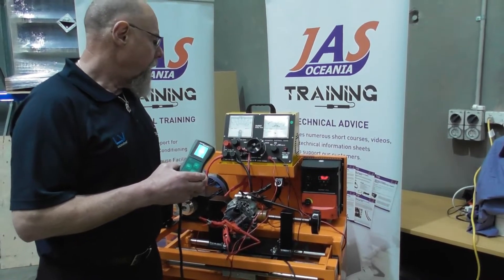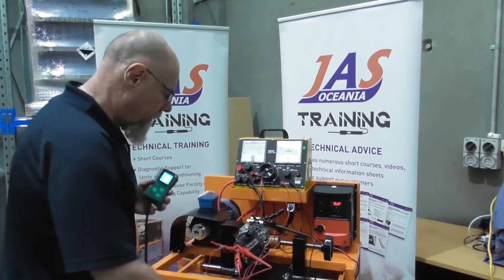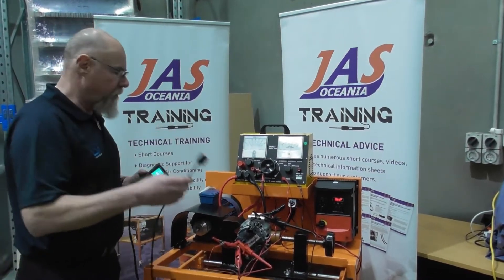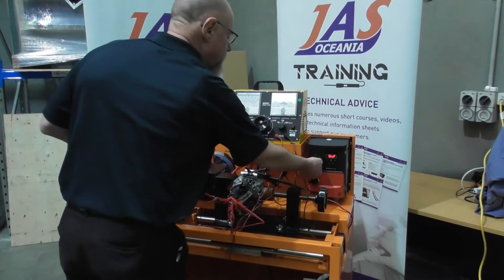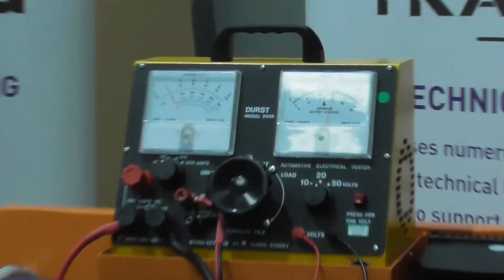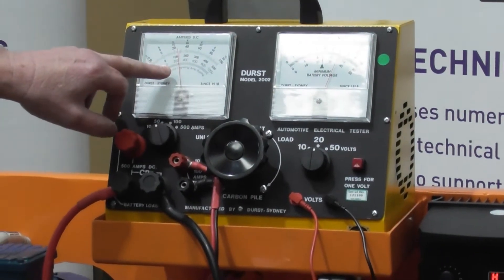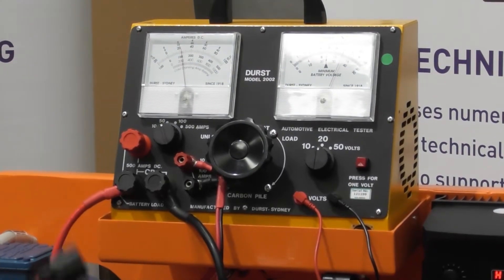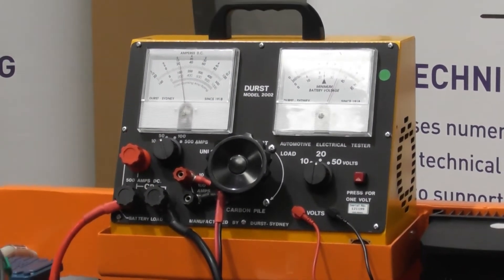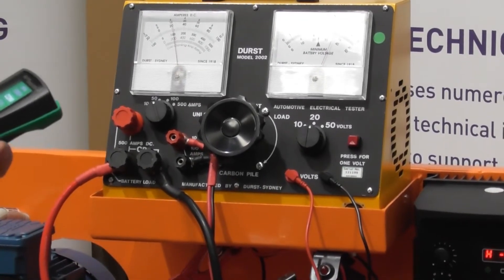The first feature is that most of these computer controlled alternators — and I haven't seen one yet that doesn't do it — will self-excite with enough revs on the car as a basic test with no plug on the back of it. So I've got the tester unplugged at the moment, nothing on the control plug of the alternator. If I start the test bench and run in the normal direction, the alternator will self-excite and sit on about 14 volts, and the amperage will depend on the battery condition. So that's just a real basic test — if you start the car up and unplug the alternator, it will self-excite and run with a standard voltage you'd expect from an everyday alternator.